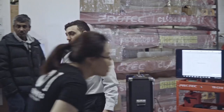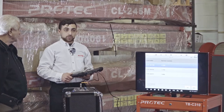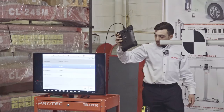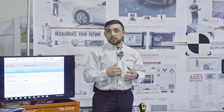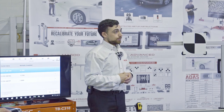Make sure the ignition is on — the tool reminds us because on cars with push-button start, they like to time out. The calibration is successful. All we have to do is set up everything precisely — our conditions are acceptable and the calibration goes through. These calibrations are not done in the tool; they're done in the car. The scan tool is only telling the camera to start the relearn procedure. Once we do that, it's all up to our setup and environment — the car visualizes the targets and memorizes the distance to use while moving on the road.